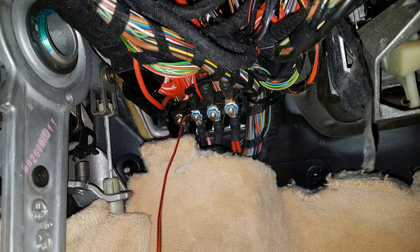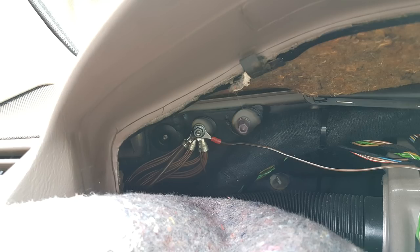For giving the gauge 12 volts, you have to connect it to a switched source so the 12 volts are only supplied when you turn your ignition on. I took the switched 12-volt supply from right behind where the parking brake pedal is located - if you trace right behind there there are four connectors and one of them supplies switched 12 volts, so I took the red wire from there. For the ground there was a location right behind the instrument cluster where there are a lot of ground wires connected.